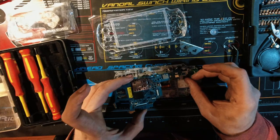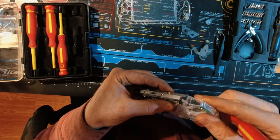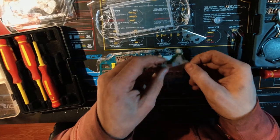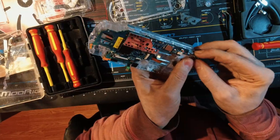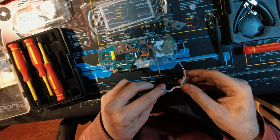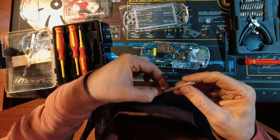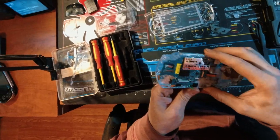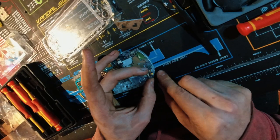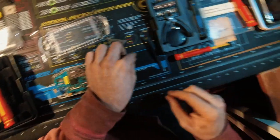Now we can put this back in — make sure this corner goes under, make sure the port goes in, make sure it goes into those alignment pegs. The antenna is now in place. We can lay this down over top, which goes on this peg right here. Now this guy can just slide in and just sticks down. Now let's put these back on — this also has the barcode on the bottom for the serial number, so that's neat because it will still match. Now we can put this board back in for the power switch. Put that ribbon cable in and just make sure it falls right in that channel for the switch, then screw it in.